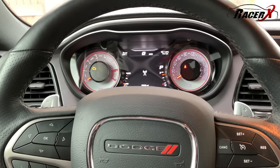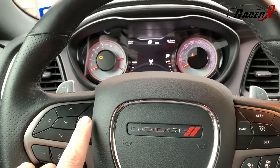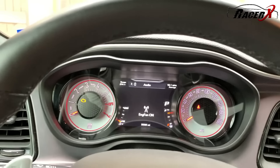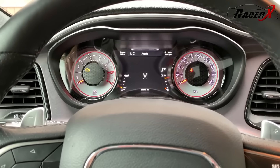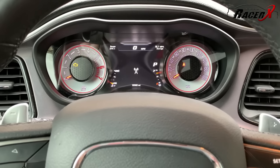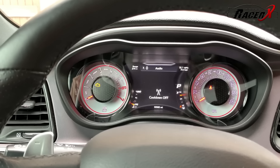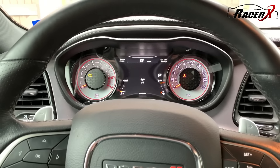In order to use the cool down feature of the Taser, it's actually quite simple. All I have to do is hold down the right button and then hit the cancel button right here, and it will turn the fans on. Engine fan is on — it's cooling the car and the engine is not running. So this is a really neat feature; you can use it whenever. And to turn it off, it's the exact same set of buttons — simply the right button and hit the cancel button — and the cool down feature is now disabled. I absolutely love that; I think it will come in very handy at the track.